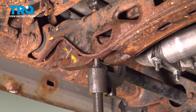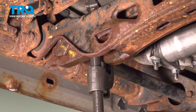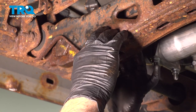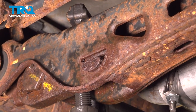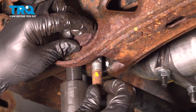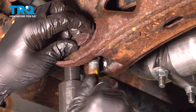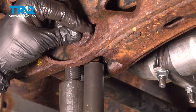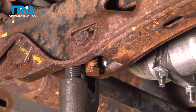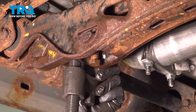Our key is going to be able to twist up inside this bracket — let's go ahead and tighten this, bring our key up, and then put our key lock in. Line up our key lock. We put some anti-seize compound on the threads, and we have our crayon mark right here. So we're going to tighten this up until it hits the edge of that crayon mark. If you had counted the rotations spinning it out, simply install it counting the same amount of rotations. Once we're right at that crayon mark, our tool is actually loose, so we can go ahead and relax this and pull that tool out.